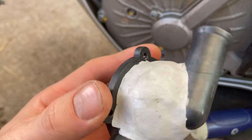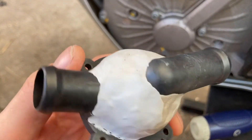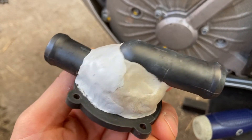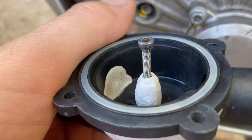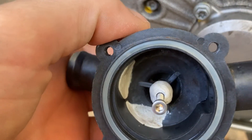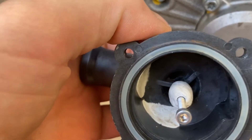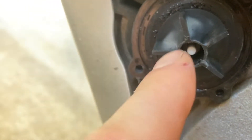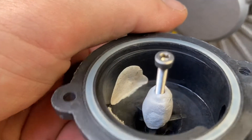You could just put a little bit of this stuff — it's like making your own guard for it. Just putty this stuff on there and build it up so it doesn't break on you like it did on me, because you don't want to wait five months to get a new one. I've reinforced the area for the impeller to go into and stuck a bolt in there that's about the same diameter as the little impeller pin. We'll probably have to go in there with the Dremel tool and grind that out so it'll fit.